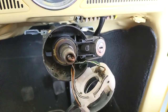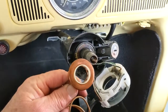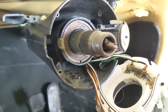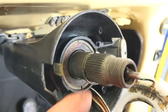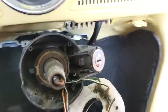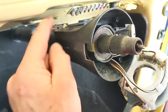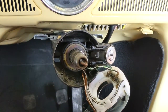I'm burrowing down into the steering column and you can see the main bearing — it's got these couple of plastic locators sitting in here. Getting in to get that out is my next mission. There's a little circlip on here I need to get off — hopefully it's the right size and fits over the spline. I'm also going to look at separating the cowl, as I've found a couple of socket-headed cap screws underneath, which should make installation of the ignition switch a bit easier.